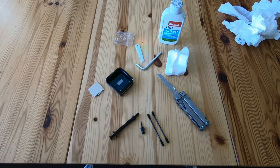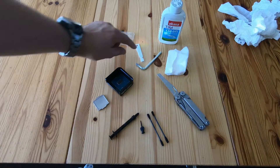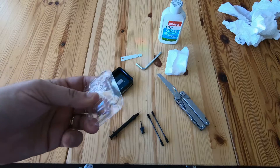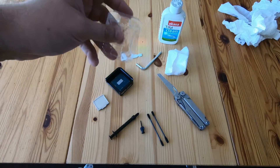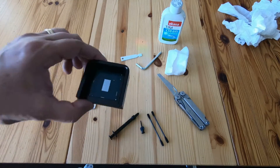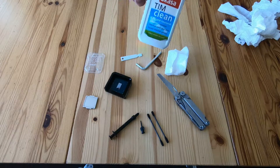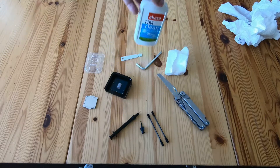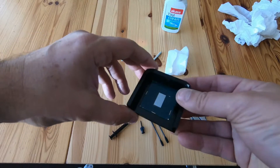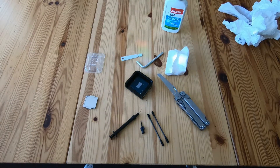The CPU and its lid are now clean. A couple of tips: I was planning to use an Araldite spreader, but the box the CPU came in was actually quite helpful — just use that to scrape the glue from the lid and any residue from the CPU. I used TIM cleaner, which is actually citrus-based — essentially lemon juice, so you could use that. I did the cleaning with it still in the removal tool so I didn't damage the delicate circuitry on the back.